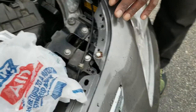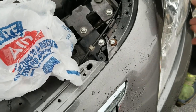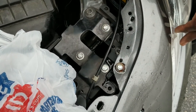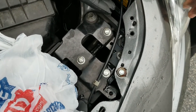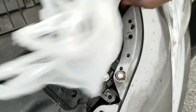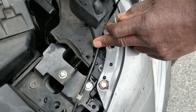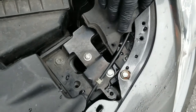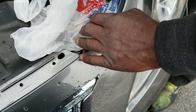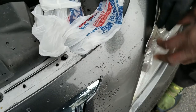The only way I could figure out that water got in here — I took the whole light and put it in a big container of water, and it fills up. Water starts rushing in pretty quickly. There are two breather areas for this headlight assembly — little nipples that come out with a cap on them. Water was coming out through that when I took it out of the bucket, so I figure that's the only way water is getting in. This hood gasket here was not fitting properly, so I'm figuring the water got in down here and went in the front breather and not the back one. This is why I'm testing now — I have this plastic bag right here so any water that gets past this gasket will run off and not get into the light.